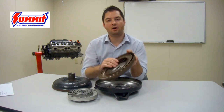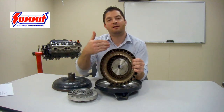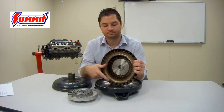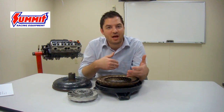We can alter torque converter stall by changing the fin angles and the size of the torque converter, which affects the amount of fluid flow throughout the assembly. This in turn affects how high a torque converter stalls and how quickly or slowly it reacts — making it a critical component when making engine changes, changing camshafts, and determining how a vehicle will accelerate from a dead stop.